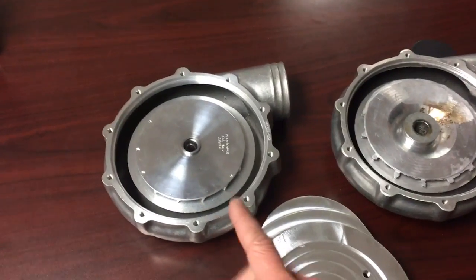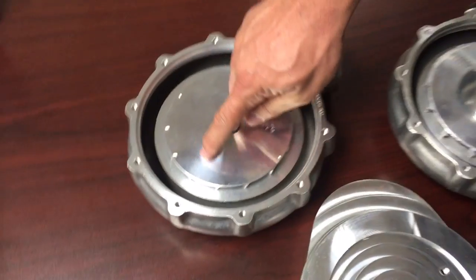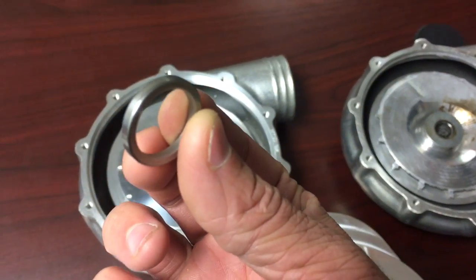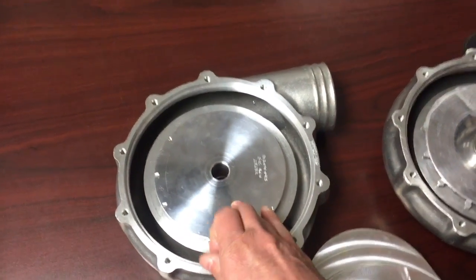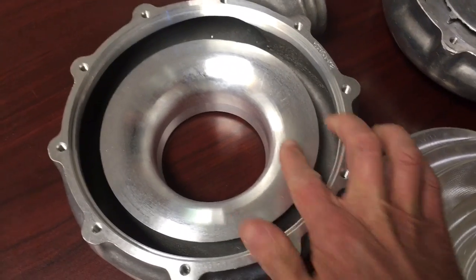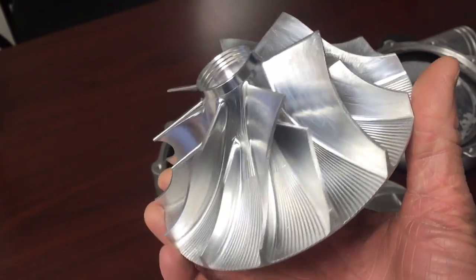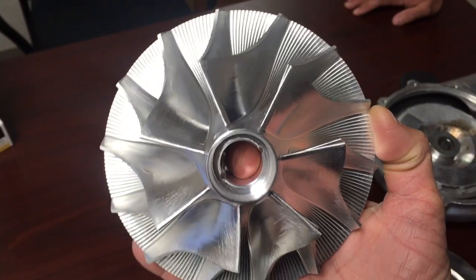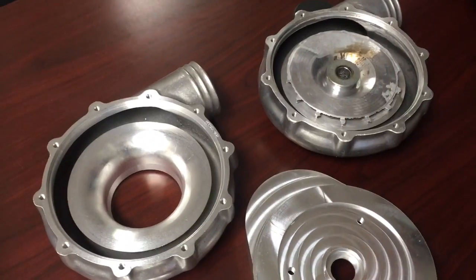So both of these are — well, this is an F1A, a real strong unit, makes big power, about 1100 horsepower or something. A lot of guys use this in about the 900 horsepower range, well balanced. So what we have here is a pinion shim — this piece is machined. I don't know if you can see it clearly, but this is a very precision machined little piece. This goes on the shaft that spaces the impeller correctly into what we call the impeller pocket. The impeller pocket is a nice taper made to match the impeller. The impeller itself is CNC-built aluminum, done on one of our DMGs here in the house. Very nice unit — this is an F1A impeller, a little bit older design.